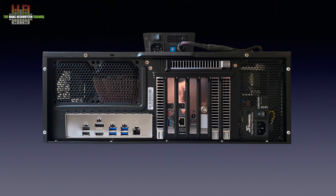The internal power supply for the computer components is on the right here, with the power inlet and main switch. On the opposite side we find the standard computer interfaces: two USB 2 ports, two video ports — one HDMI and one DisplayPort — then four USB 3.1 ports and an Ethernet port. The true audiophile ports can be found in the extension slots. The USB Audio Class 2 output has a switch to switch off the 5V power line on that USB port. Most DACs need this 5V to have their interface chip identify itself even when the DAC is switched off. Some DACs don't — these will not identify themselves when switched off, which might lead to software losing its setting, so you have to select a DAC time and time again.